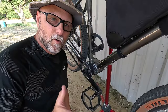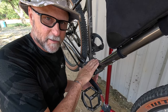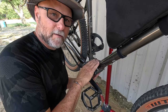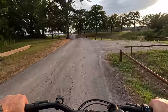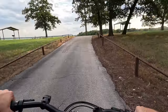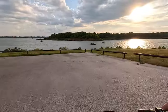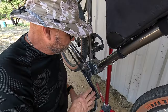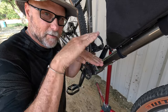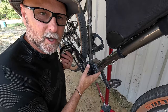And it has more gearing equivalency than really any mountain bike that you can get. It's a 600% gear ratio on this. And most mountain bikes are like, I think, 525 gear ratio. So it's 12 speed, but it's very low and very high in terms of all of the different configurations that you can get to. So you can climb the steepest of hills, and you can do some of the most rapid descents, and I'll get into the gearing later, but there's zero overlap with the pinion gearbox. It's like when you're at one gear, then you go boom to the next gear, boom to the next gear, boom to the next gear. There's never any overlap, but just extremely low maintenance.